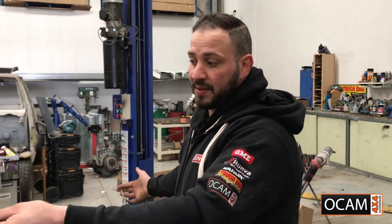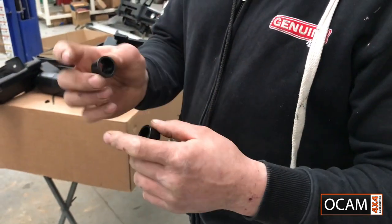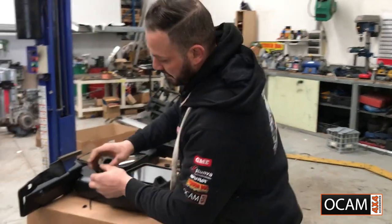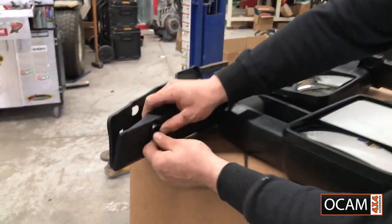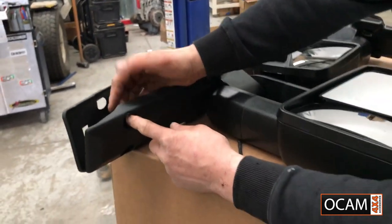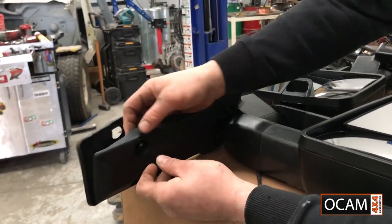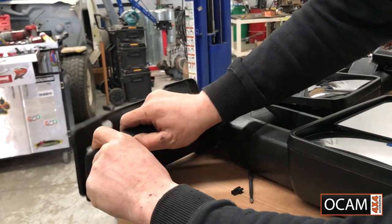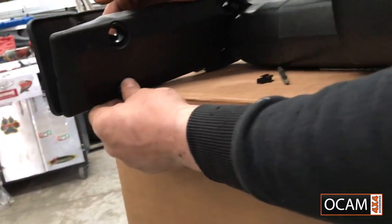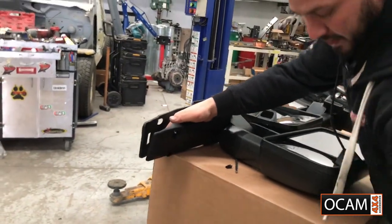And then connect your clip and then bolt her up, making sure you've got a nice seal with the actual rubber that comes in the kit. You've got four of these in the kit, and that's actually a spacer style, so it holds into the actual housing, and that goes on the front side, and that pops in there, and that allows you to put your 6mm bolt, 10mm head through there to actually support this onto the body. So we'll go ahead and do that. If you can't see them 100%, once you start tightening, they'll seat in perfectly. It is a very snug fit.